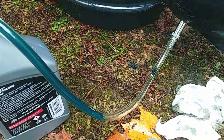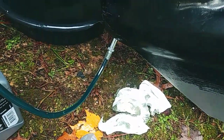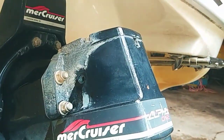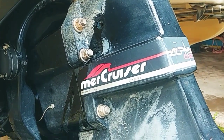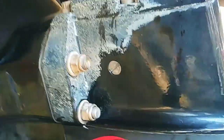See how blue this is and clean compared to that. You can see the blue stuff I spilled — I got a little bit in there because I put this in first and then had to take it out. See how different it is — it'll be good to get this changed. I'm going to keep pumping it up through until I see it coming out up here. Once it's out up there, I'll put the cap back on, wipe it down, and keep pumping until I pump it up into the reservoir. It took one whole bottle and just a little bit of the second one to get it to come out the vent cap.